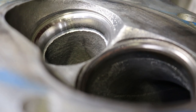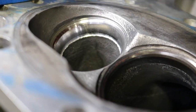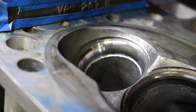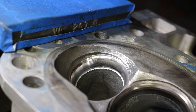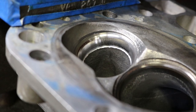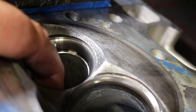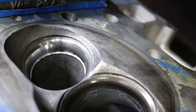This is the cut seat. The profile on the seat matches the profile on the cutter. The next step is I'm going to lap this valve in and see where the seat's making contact with our intended seat patch on the contour, and see if we need to move in or out. If everything looks right, we'll either adjust or go down the line and do that to the rest of them. This valve job is what I would consider far more aggressive than the one that was in it. Our throat is already just a little bit bigger — it's a 55-degree seat with a radius.